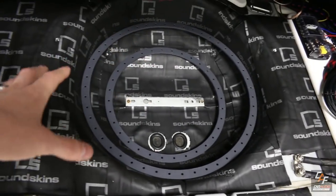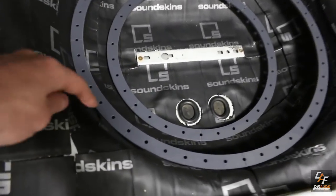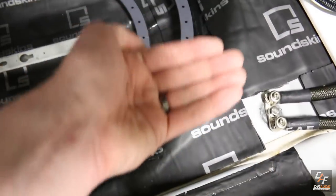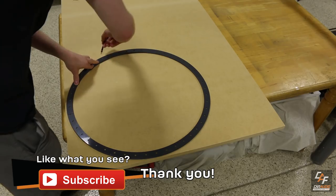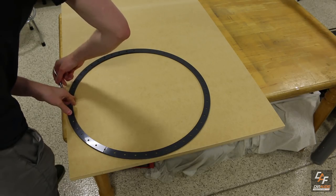You can also approximate additional air volume using depth times width times height for a rectangular prism and add that on. So I've got a plan and I can start cutting my layers. I'll start with the first base layer that mounts into the vehicle. Rather than making the small circles first I'm starting with the large circles so I can use the inside cutout material later on, maximizing the efficiency of my wood use.